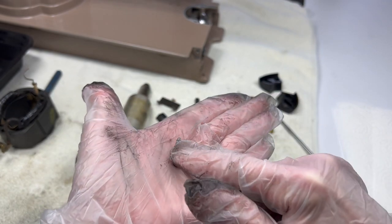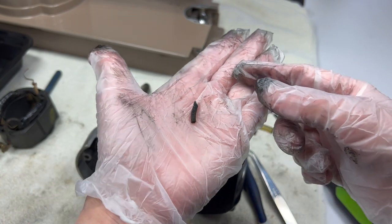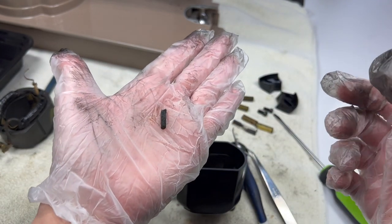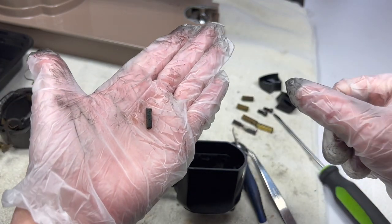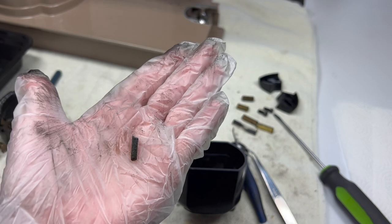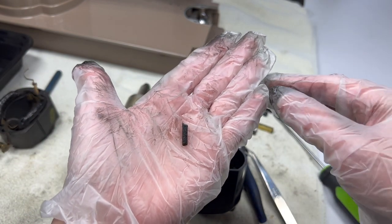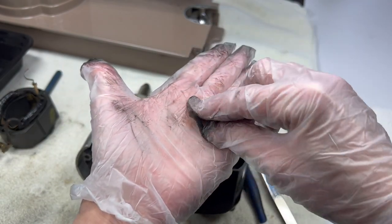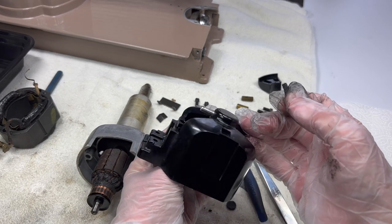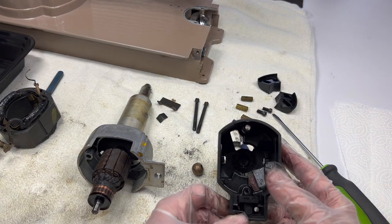This grease wick is pretty hard so I'll try soaking it in rubbing alcohol or a degreaser. I've tried all different kinds and Crud Cutter has won the contest for me, but I have to be careful getting it on paint finishes - it doesn't strip the paint on these tan ones but it will take a little of the shine off, which you can polish right back. On a black-painted Singer I wouldn't come near it with Crud Cutter or alcohol - that's a different ball game. I'll clean this and put it back in.